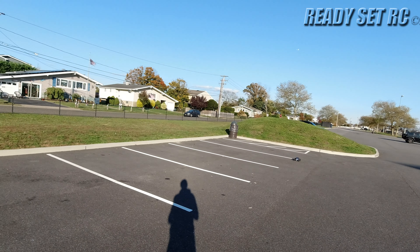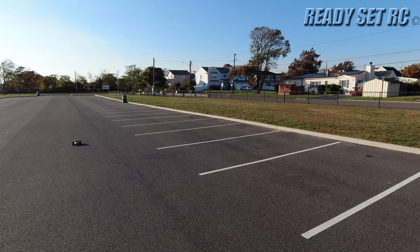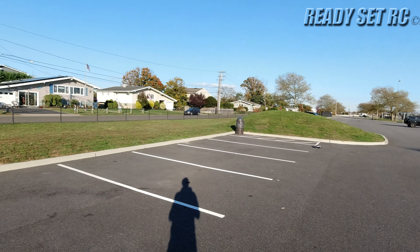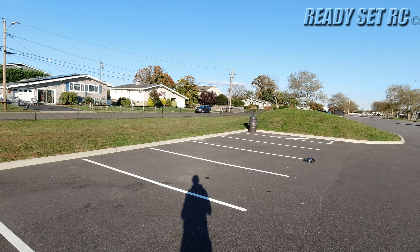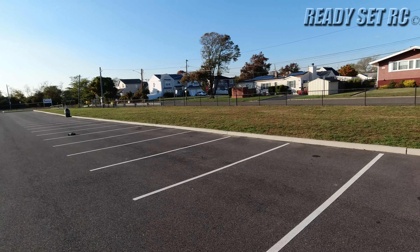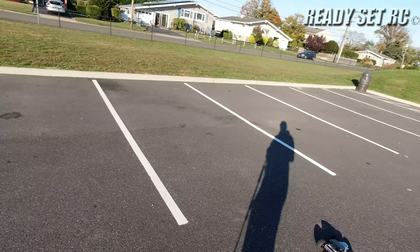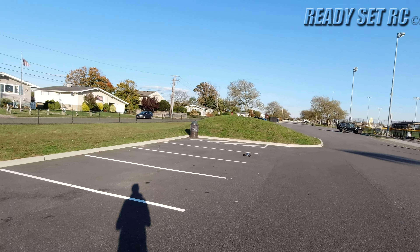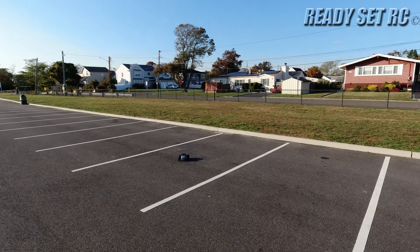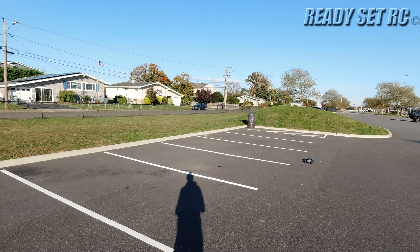I love the Merv — these overpowered ones like this are insane. I used to run a 31 tooth pinion on it and I slowed it down to a 30 tooth pinion that's on here now. I may even want to go back down to like a 28. But it's a lot of power for it.